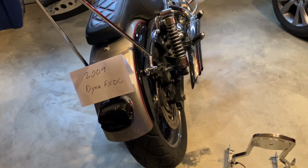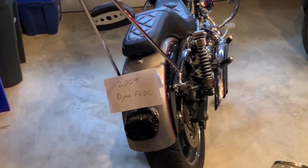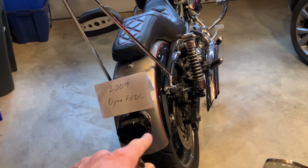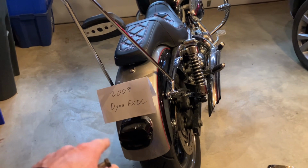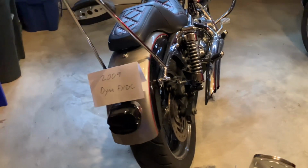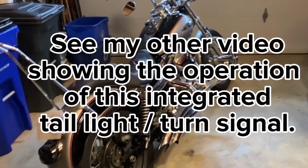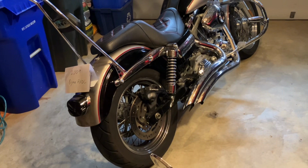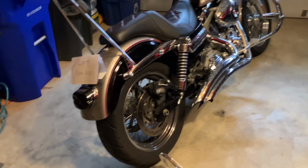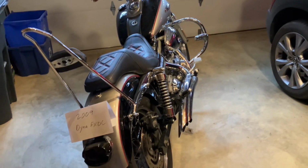So the wires for these turn signals don't come into play anymore. And then the new light has 3 plugs. One to plug in for the brake, and then it's got 2 smaller cables to plug in for the left and right turn signals. And that was plug and play. I read everywhere that I was going to need possibly a load equalizer to get the turn signals to flash correctly, and that I would have problems if I didn't use one. Well, I just tried it without any load equalizer, and it worked the way it was supposed to.